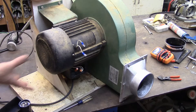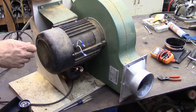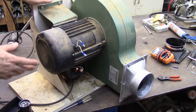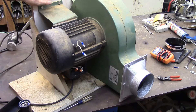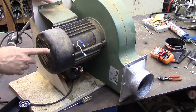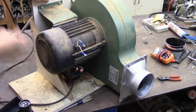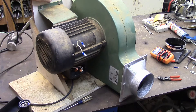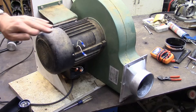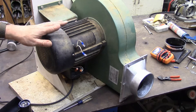If you want to double check that, you can take the end off — there's a fan on the end. When you plug it in, you just have a couple of seconds before it blows the breaker, but if you take a stick and flip that fan where you're acting like the capacitor, it'll start kind of going and then it'll probably blow the breaker.